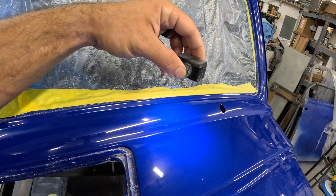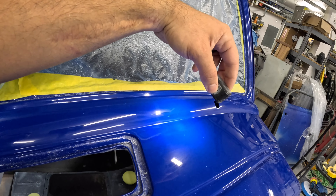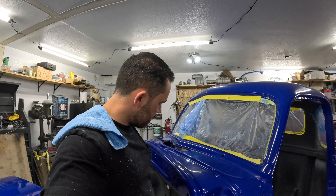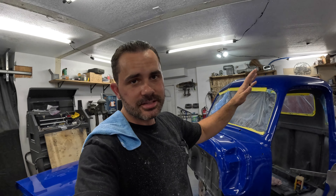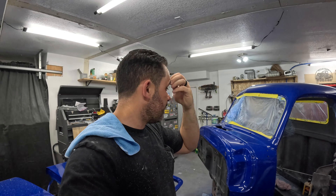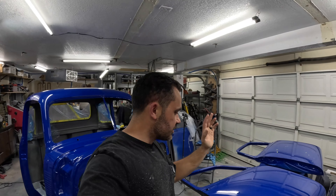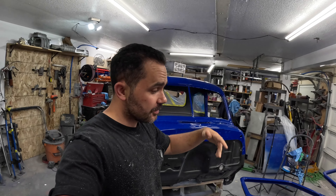I can see it really easily in person. Was that a good repair? No. It came out just about as good as paint pens really do. But it was worth a try — I definitely did not want to have to respray it. I'm still going to have to scuff it up a little bit just to blend some paint in. But we're going to worry about that later — that's done. Now that that's protected we can worry about it down the road when we have to do other repairs. The good thing is I didn't do it on the door so it's only going to be one area we have to worry about. It does suck, but we didn't do it on the doors — we'll fix those later. I'm not cutting and buffing these doors in this video. They're going to get put away.